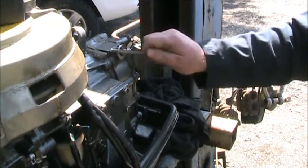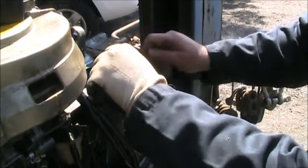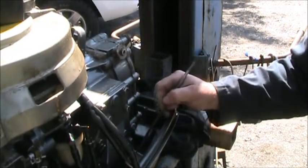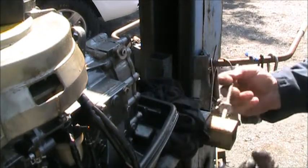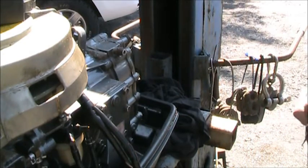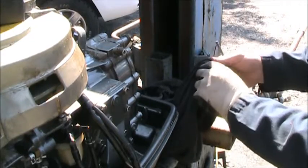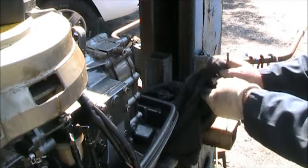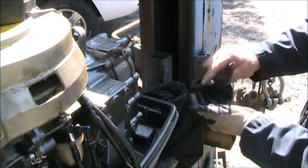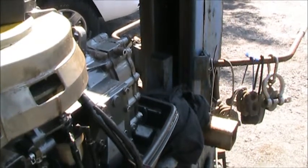So, clean up them grounds all over the place. Clean them up. I'll drop it again, I get it. All right, clean up them grounds really good. Ain't no need to have no rusty grounds on there. Ooh, look at that nasty. Get that out of there. Only takes a second. Get all that yuck off of there. I got three of them here. All right, so you get the idea. Clean up your grounds, make them shiny and pretty. Get you a good ground.